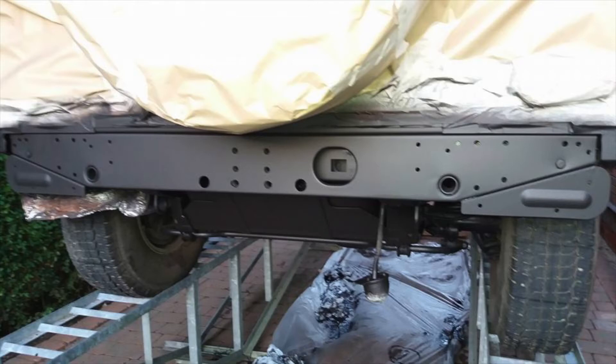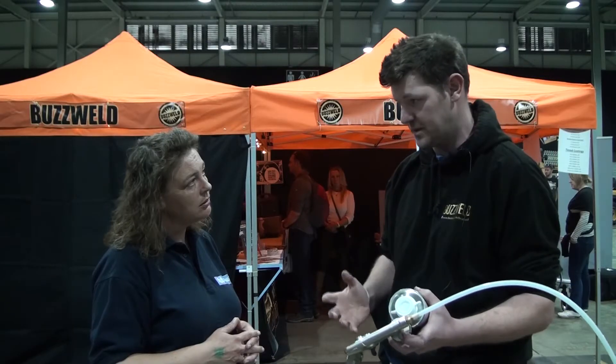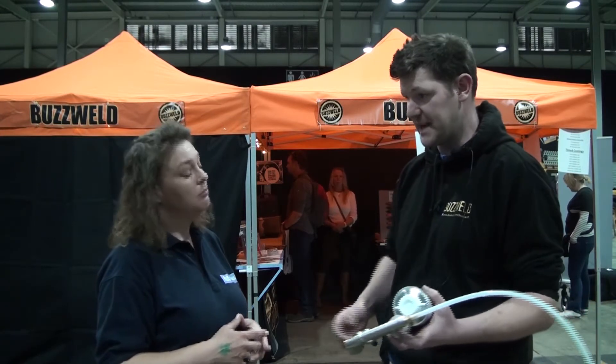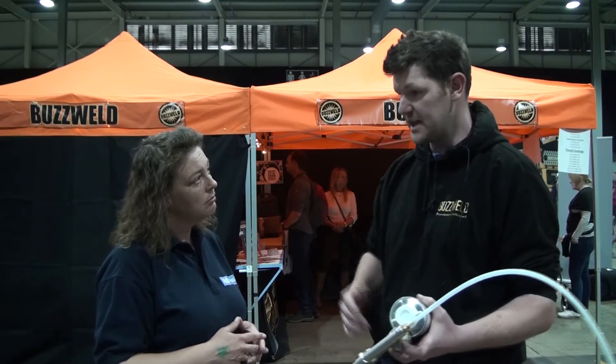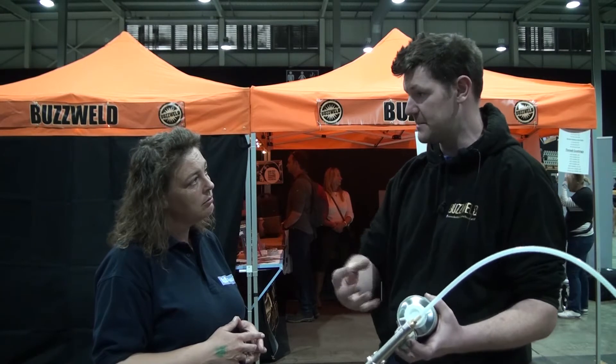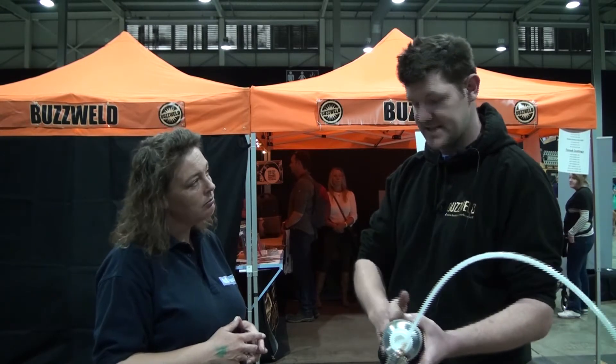There's a certain amount of creep — a lot of people will say 'you put a wax in and it'll creep all throughout the chassis' — the reality is it won't. You really need a VCI for the higher end of protection, and if you're going to have mud go throughout the chassis you want the whole lot protected. So if you're going off-road, go for a VCI-based product like Zero Prep or WAR. If you're just a road-going vehicle and you put enough in, then the self-regen wax is a really good budget option.